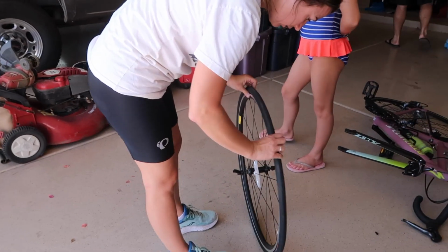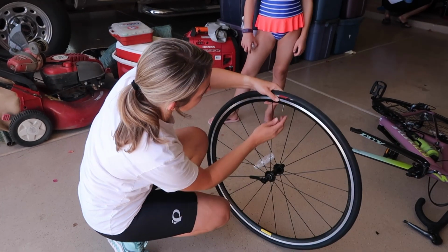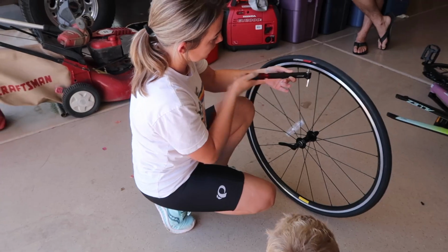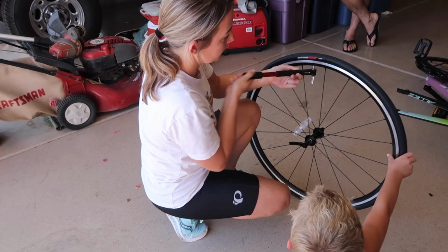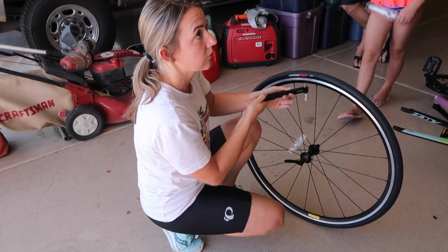So now you want to pump the tire up. And this is where, if you have a CO2, you just put it on and go pop. Because she's going to want about 85 pounds of pressure at the front, and a CO2 will take this up to 90, but you're not going to hurt it.